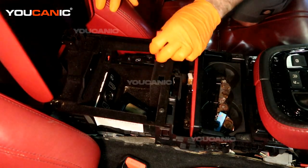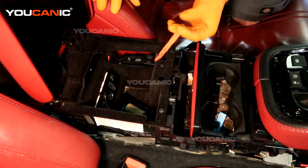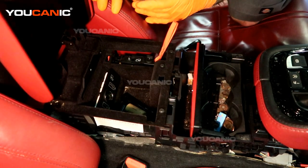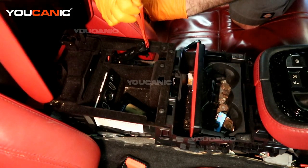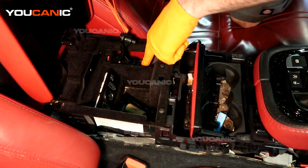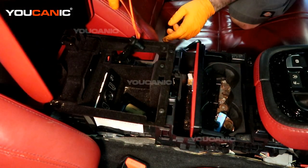This right here is your safety park neutral switch. If you pull this, your vehicle will be able to roll forward or backwards, so make sure you're on a good level surface and that the tires are chocked. You will have to pull this and bring it up — as you bring it up it pulls a cable that releases.